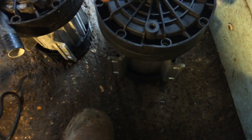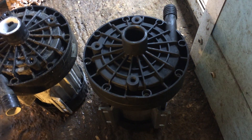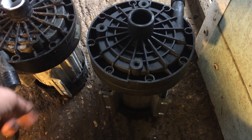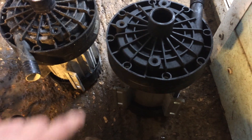So we can turn the pump off and split it on that joint — just take all these bolts out, about ten of them, to split it around. Just be careful you make sure the o-ring goes back in place and do all the bolts up. If you leave one loose a bit it'll leak. Don't ask how we found that out.